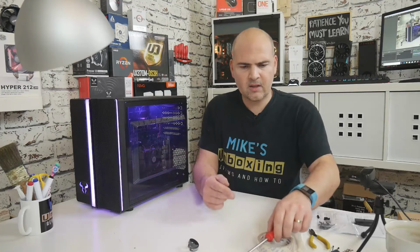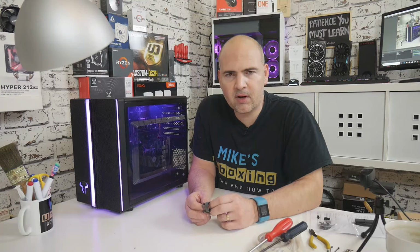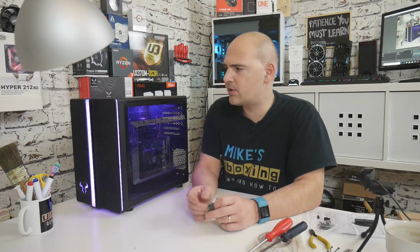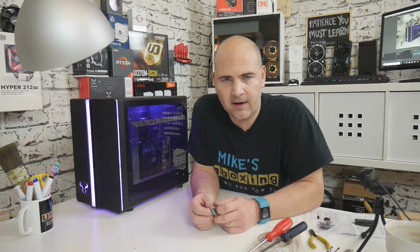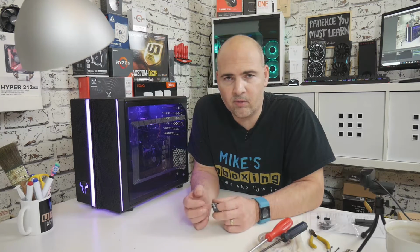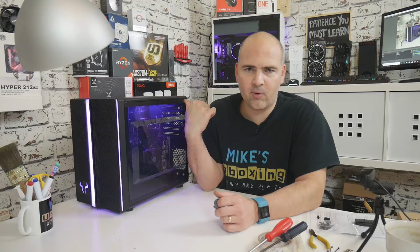Let's have a look through and see if there are any questions I haven't answered, Kath. Yeah, any clue how removing my CMOS battery on my motherboard for like 2 minutes didn't clear CMOS? Had to short pins. Did you remove the power plug from the back of the power supply? I might have to repeat the question. If you can't hear, someone's asked why removing the CMOS battery didn't reset the CMOS even after an extended time. It could be because you left your power cord attached.